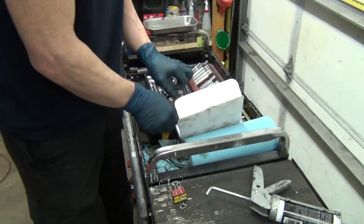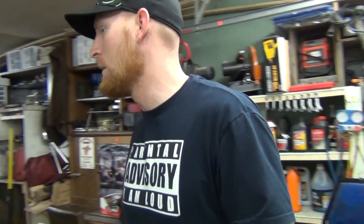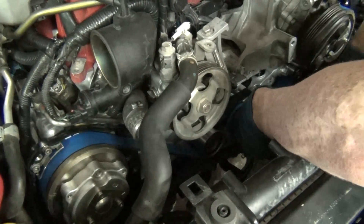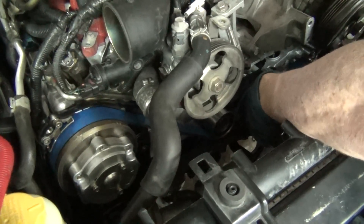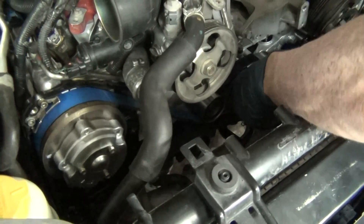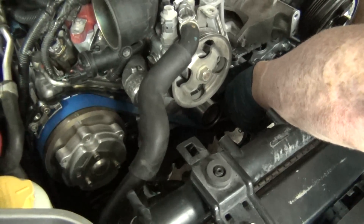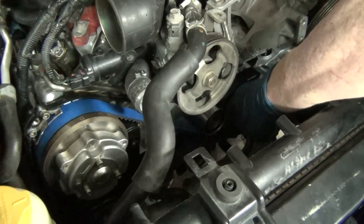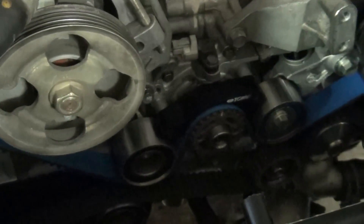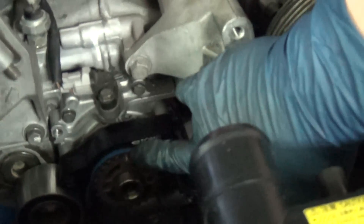I do a lot of Subarus — day in, day out, every month — so I thought it would be worthwhile to build that tool, and as it turns out it's going to be a really handy little thing to have. What you can do is rotate your engine quickly and verify that your timing marks line up as you come back around. That's 180 degrees on the cam, so that's one full turn on the crank. I've got a busted knuckle so I'm going slow. I line that up, look here — my marks are on here, my marks are on here, and they're on down here. The harmonic balancer blocks your marks so you can't see it very well. This is nice because you can see clear up underneath the gear and see the one on the timing, or just use the one on the face. You can pull it off quick and look at it.